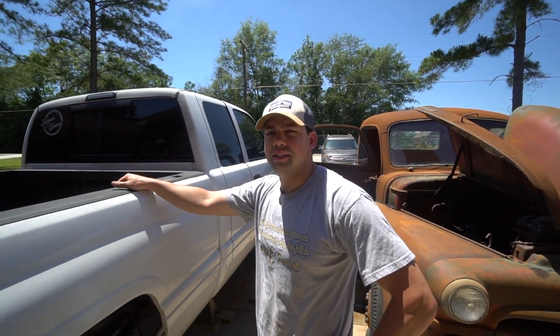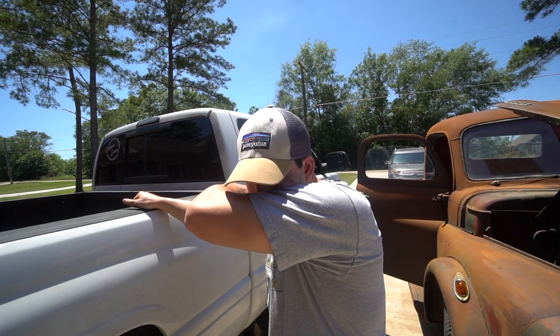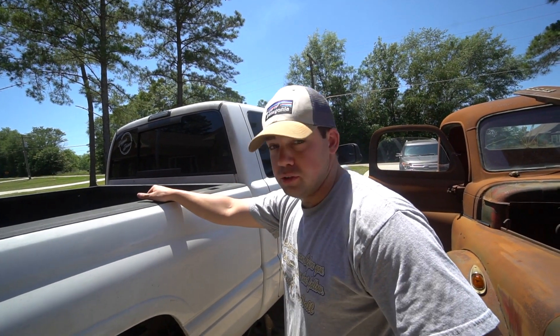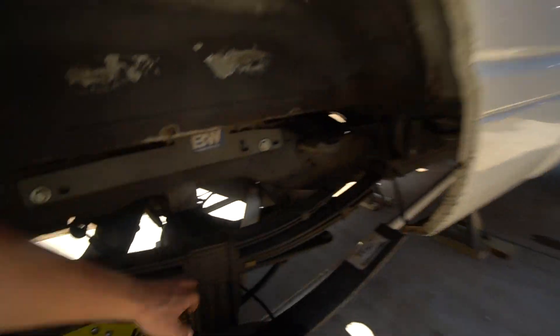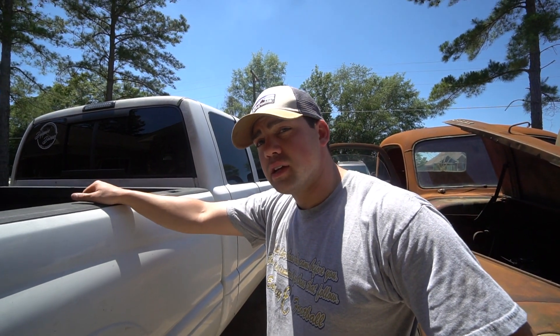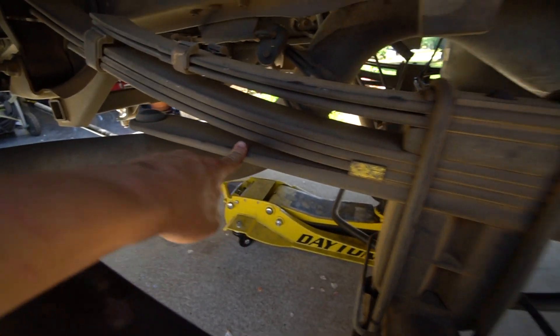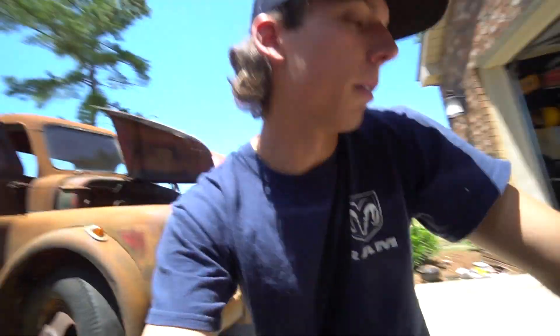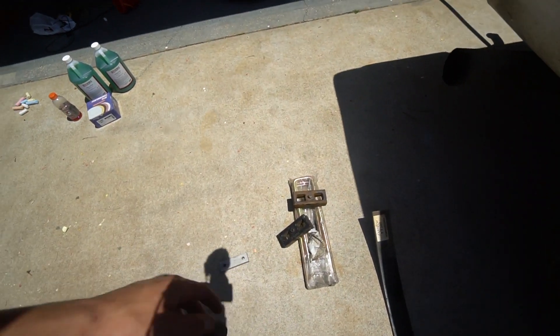How does the R&D manager say he's never seen that? We've had three of these trucks and they've all been exactly the same. Dodge apparently just threw that in there, and I've always seen it set up just like that. Maybe the '97-'98 models were a bit different, I don't know. So we're going to put the leaf spring in between the flat one and the next one, and hopefully it lifts the back end an inch and a half like he says. We won't be using those blocks.